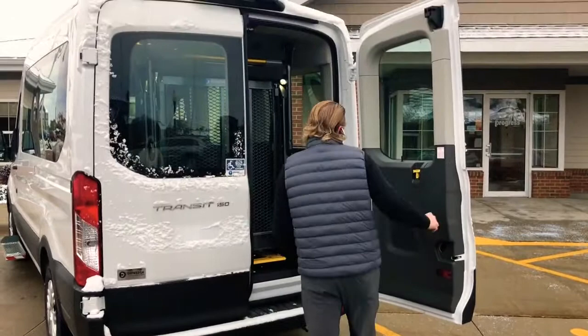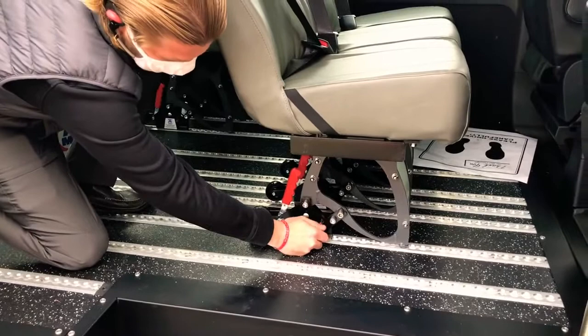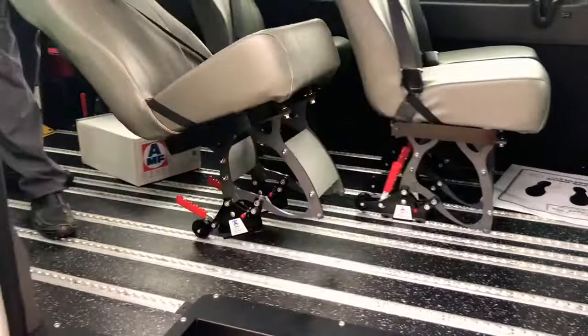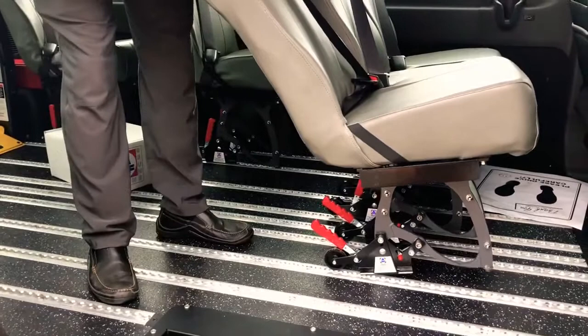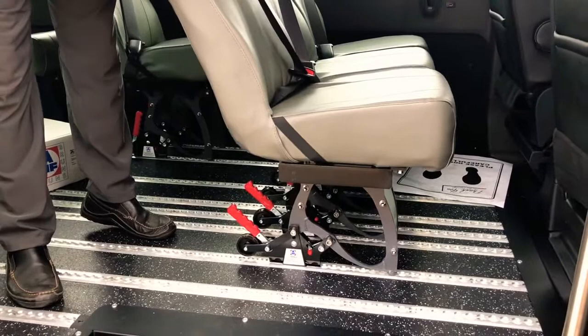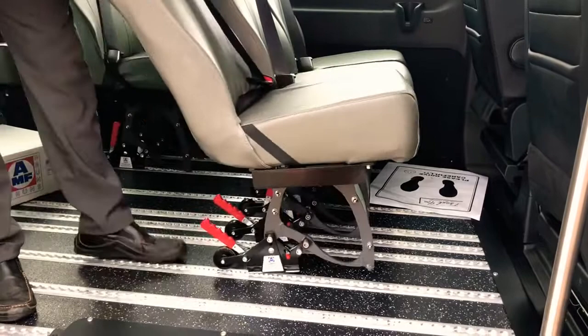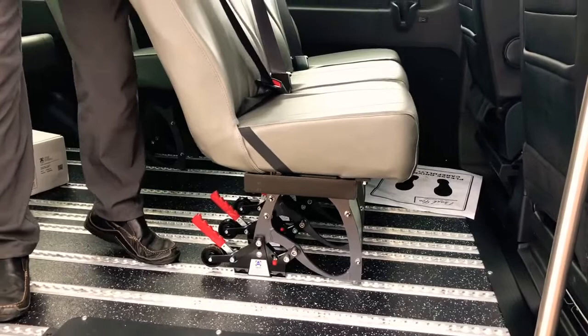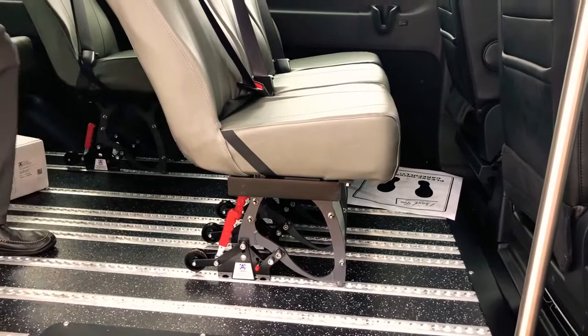The seats are straightforward — there's a pin that acts as a lock pin. To remove the seat, pull the pin up on each side and pull the handle back. The seat is then detached; there are wheels on the back so you can tilt it and roll it right out. When reinstalling, a lot of people think the front pins are what keeps it in place, but it's actually the rear track. The front pins are just locating pins. Push them forward to lock them into place — when new, they'll be very tight. Don't use your feet; use your hands only.